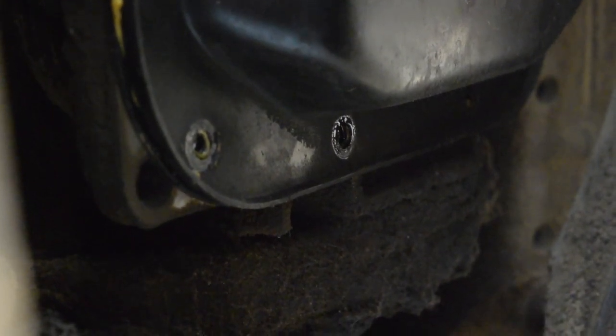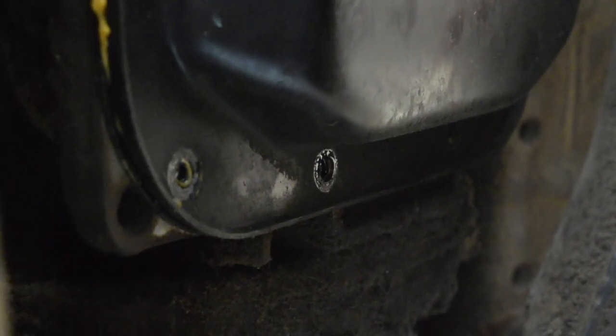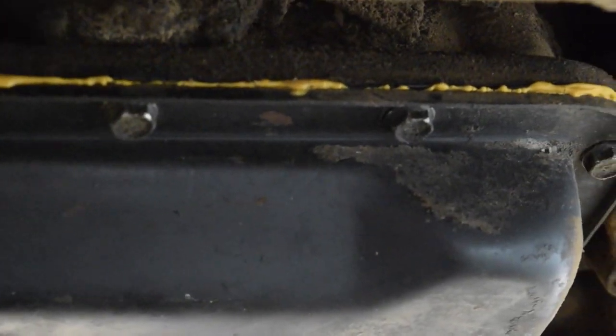It's not going to start dripping a whole bunch until I get a little flat blade and stick it in between there to pry it a little bit. You want to be careful not to scratch the mating surfaces. We want to crack it open once all the bolts are loosened — just leave the back row on, undo the rest, and let it tip down and spill out. Then once that's done we can take the pan off fully. There'll still be some fluid in there due to the way it's bent down.